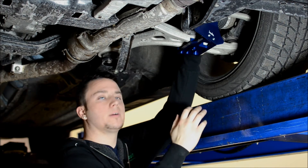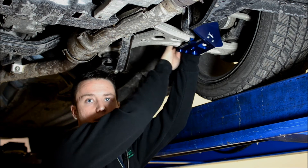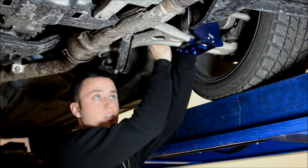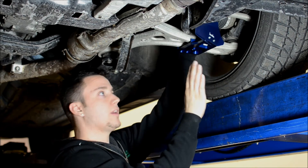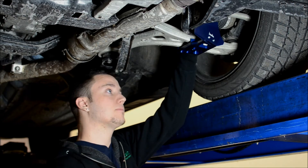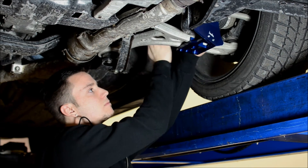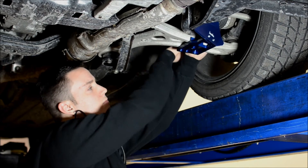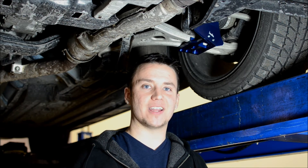If you look up through the control arm, there will be enough room to get a socket set right on top and you can just go ahead and turn down the bolt, making sure that the deflector is not going to interfere with anything and that you're not cross-threading the hole. That's the brake deflector installed on the driver's side of the vehicle. The passenger side is a direct mirror of the driver's side, so go ahead and install that on the passenger side and you're good to go.